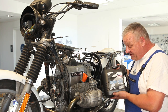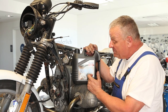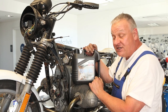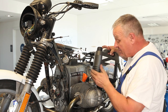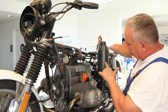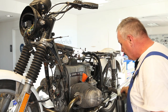Speaking of oil, this is what I like to use — 15W-50 from Liqui-Moly. It's a mineral-based oil, very high quality. The old standard for years has been 20W-50, but the cool thing about 15W-50 is it's just a little bit thinner when cold, so it makes starting that much easier, and once it gets up to temperature you still have the 50-weight protection in the motor. This is a 4-liter container, so it's enough for two oil changes on one of these. It's also graduated on the side so you can keep an eye on where you're at as you use the oil. We need to use about half of it — let's start with two liters.